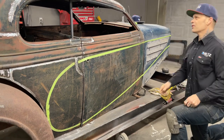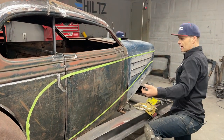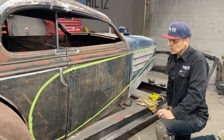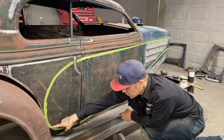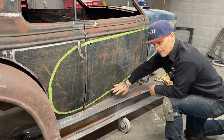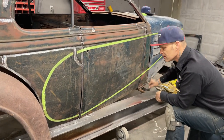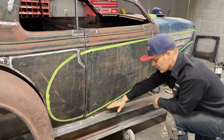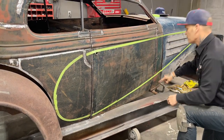And if you think on the Model A fender, I can run that square tubing all the way up if I have to do anything with any fender. The door will be left there. When I weld this on, I will weld it on the quarter panel, and I will weld it on the cowl. I'm going to weld it on the door too, because that's the metal that's welded to this bar to hold the fender. I'm going to cut the door free after.